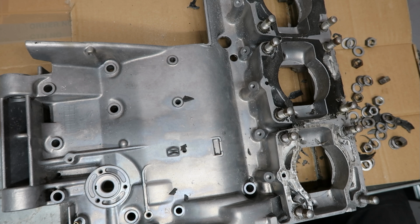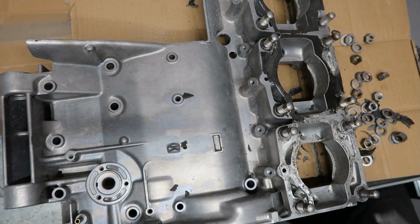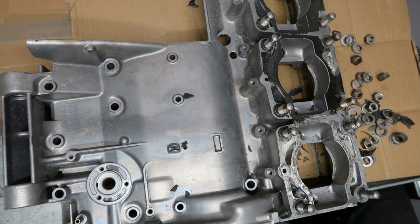Say the Honda CB400F has shell bearings. If you do not meticulously clean the oil galleries, it destroys the bearings, absolutely destroys it. And because these oil galleries are really small, you really struggle to clean them, and all that build up there, look. My recommendation would be that if you have an engine which has shell bearings, do not blast, hand clean.